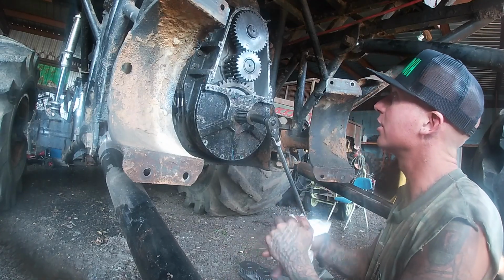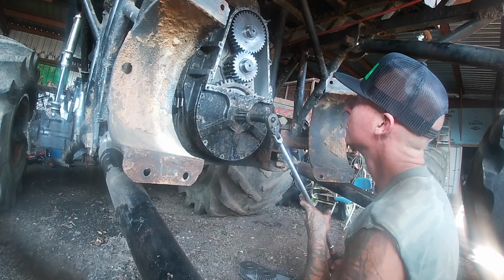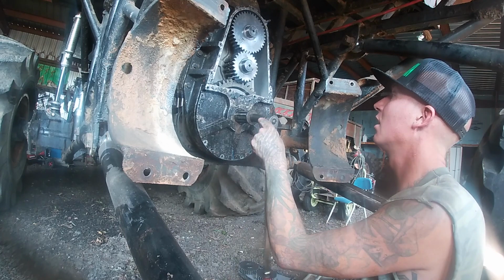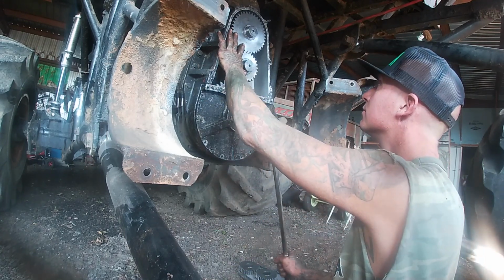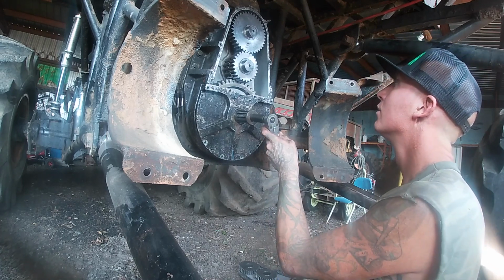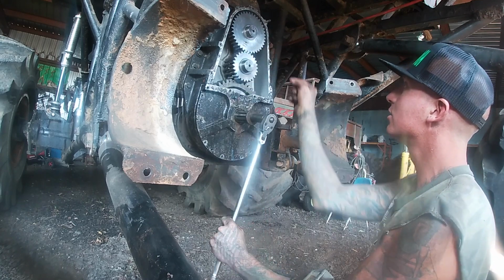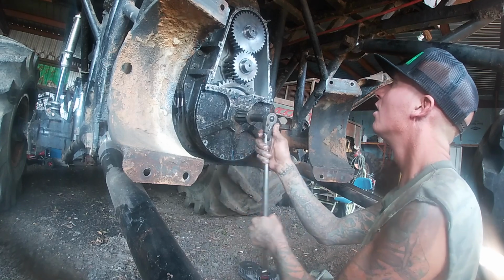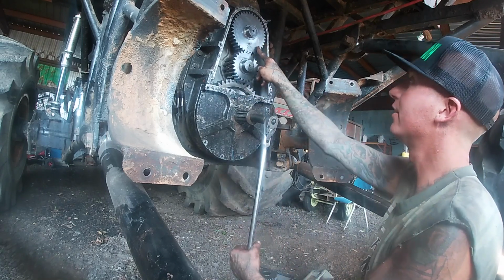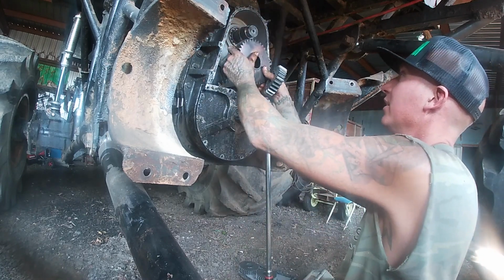And I'm going to turn that bottom gear one turn and count the turns on the transmission gear. So here's my line marked on my lower gear. And I'm already not certain what happened, so let me get that line back. Alright, here we go again. So that was one turn of the transmission. Looks like this is 2 to 1. Here it comes around again. And here comes my line. So 2 to 1, like this. 2 turns for the transmission gear, 1 turn for the transfer case output. Now I'll swap these, and I think that should put it at 4 to 1.